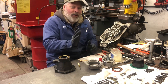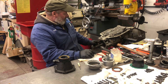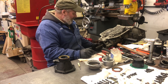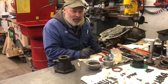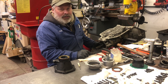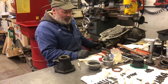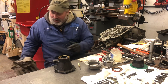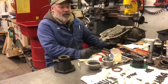I already installed my seal. Now unusual — this is a two-wheel drive '68 Impala and the O-ring is on the shaft. So this slip yoke for the drive shaft obviously goes up over the O-ring to seal, and there's a weep hole in the very end of it. I seriously doubt it has a two-piece drive shaft, but I've seen that many times where the yoke actually slides over the O-ring, so typically I never get to use this O-ring. I put a brand new one on there. This transmission is out of my comfort zone because I have to put way too many parts back in — in a race Turbo 400, you throw a lot of this stuff away.